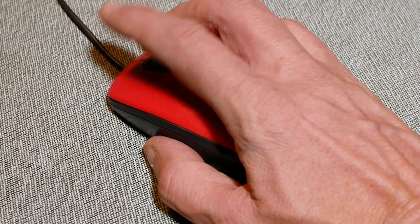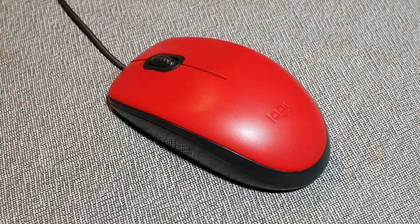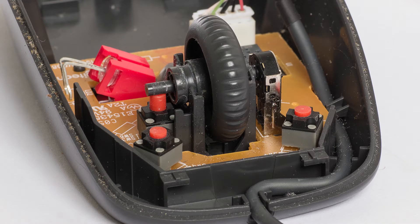Now the mouse left button works perfectly and the right side still functions with light usage. In the future, if the right or left side buttons should fail completely, I'll swap the failing one over with the middle micro switch, which I never use.